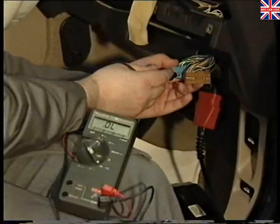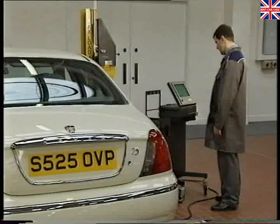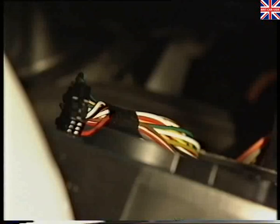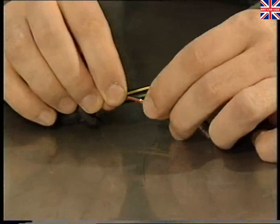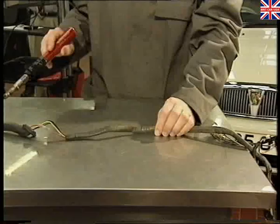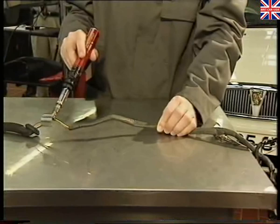Do remember, though, that although a meter can be used to check the wires, never use anything other than TestBook to diagnose faults on the bus systems. As an experienced technician, you'll appreciate that ECUs are very reliable and that most faults are caused by wiring defects or poor connections. And it's here that CAN bus has a major advantage, as there are fewer connections than on previous models. In the unlikely event of the CAN wires becoming damaged, it is possible to repair them. However, the repair information must be followed exactly, as this operation, although not difficult, does require a great deal of care. Incorrect repairs may lead to a CAN bus malfunction.